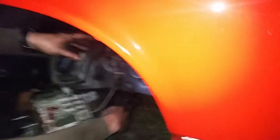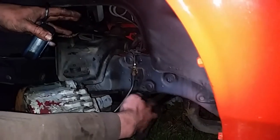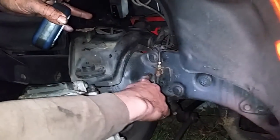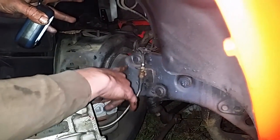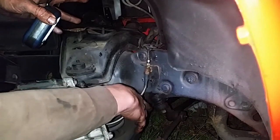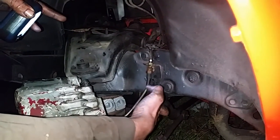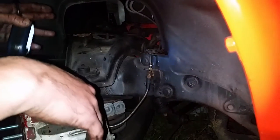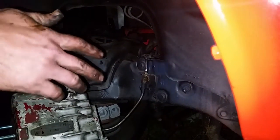Here's a key ingredient to remember. These aren't stock hoses, but these are what would be stock for a 98 Camaro if you upgraded to braided hoses. All you need is a little adapter you can get at AutoZone that will convert your inverted flare line into a bubble flare line — a metric line — to be able to use 98 Camaro hoses and still use your factory steel lines if they're in good shape. If they're not, you can replace them with factory lines off a 74 Nova.